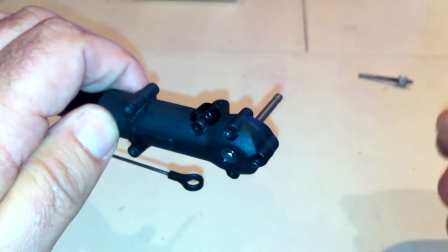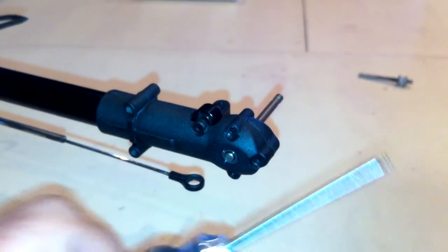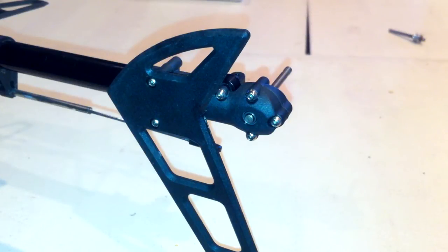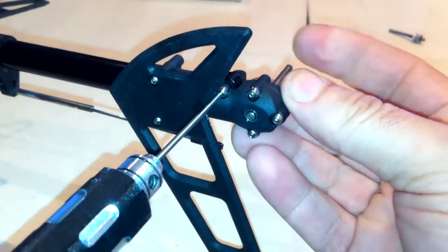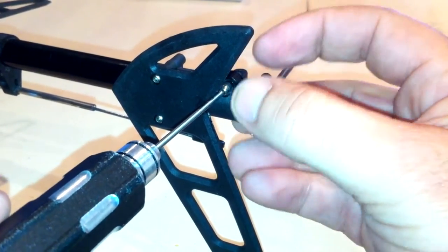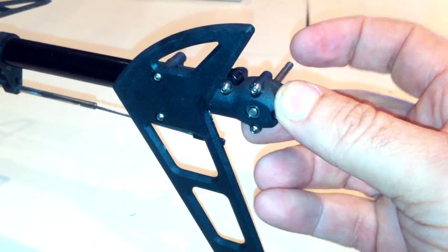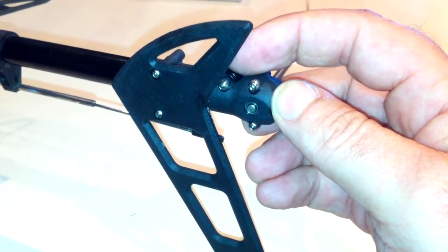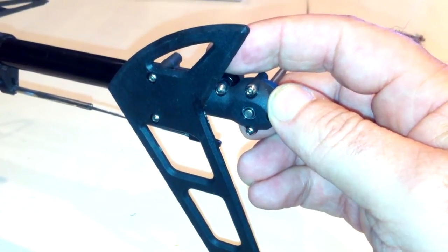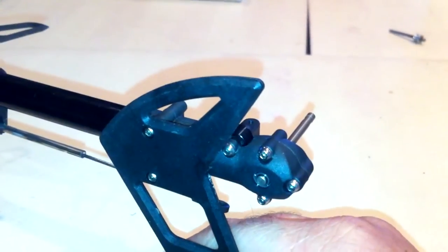And there you have it. Now you can go ahead and put all your screws and everything back in. I've got my tail back together there. Now we'll just check our little roller bearing here with this screw — just make sure that it's not over tight so you don't clamp that little roller up, which actually runs on your belt. I'm just spinning my blades around there now and I've got my finger on that, just to make sure that roller is spinning there. So it's spinning — pretty good.